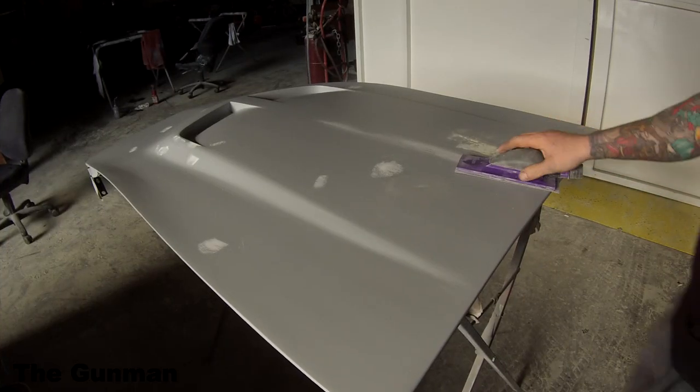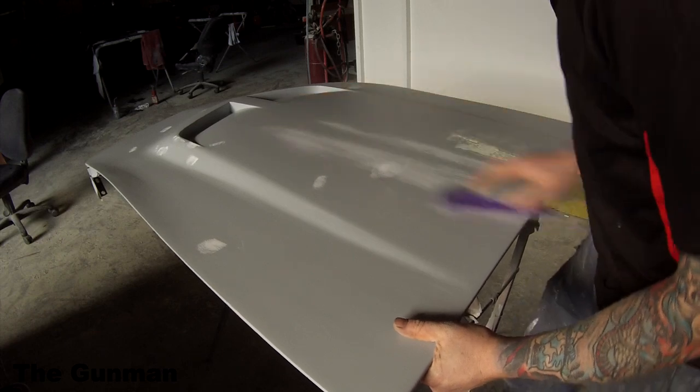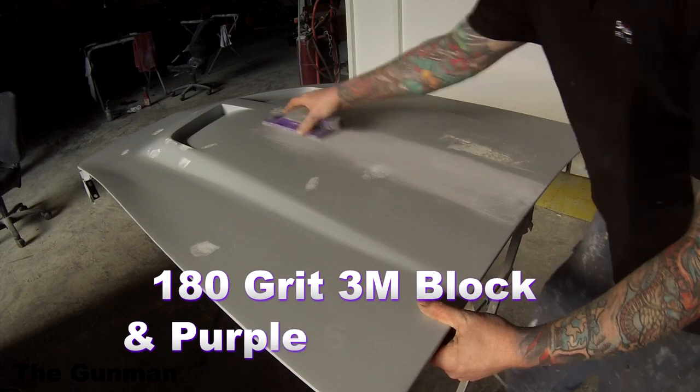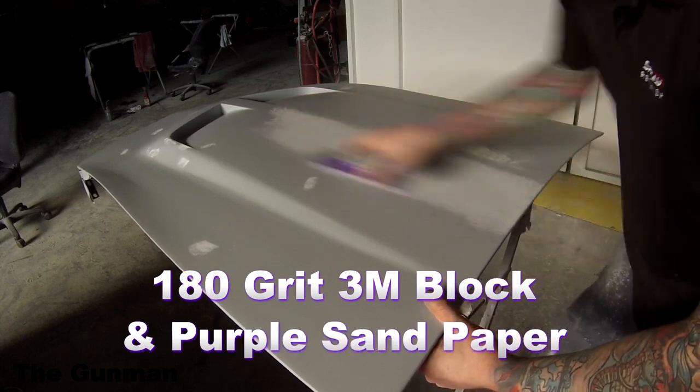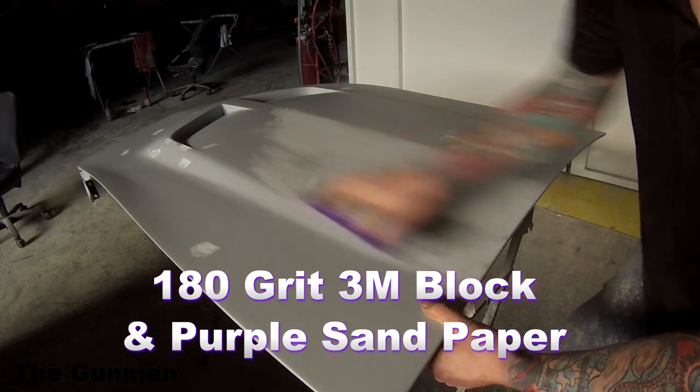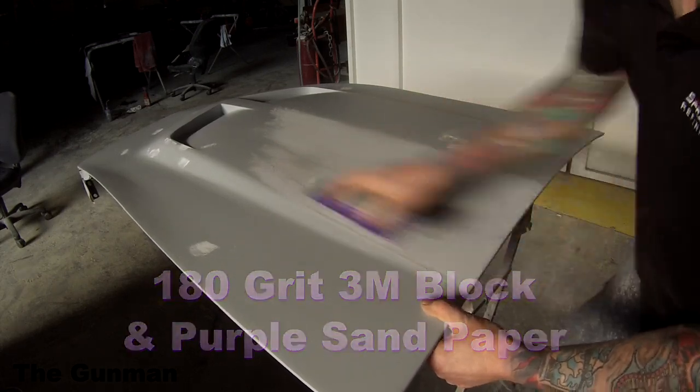As you can see, we've given it a good four coats of two-pack high build primer — the brand I used was Concept Paints HS Primer — and we left that for two days prior to sanding. We came in on the Monday, did the body repairs and primed it up, went away on the Tuesday to the airport and painted an airplane tail, then came in on the Wednesday, sanded it all down and got it painted.